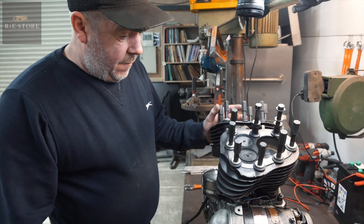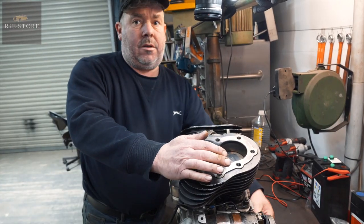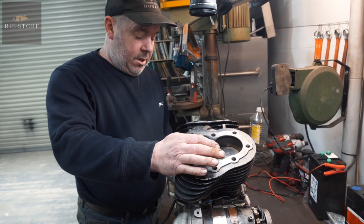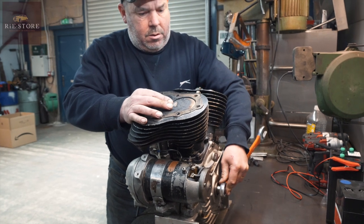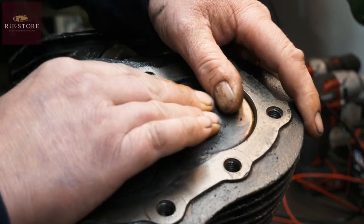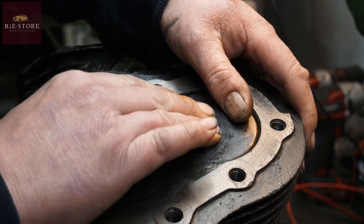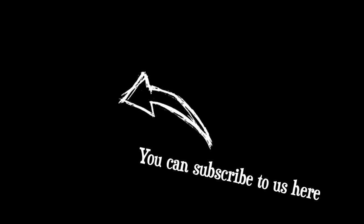Next week on the workshop - a 45 engine stripped down. Basically what I do is put the sprocket nut on there so you can wind the engine over freely with a spanner, wind them over to the top. If you can move it by hand and you can hear it knocking, that's too much play. See you next week.